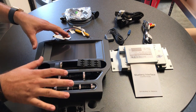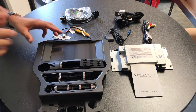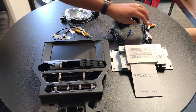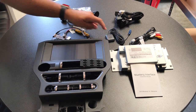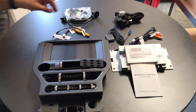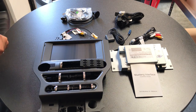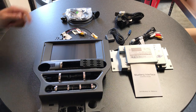In each kit you'll get the 8-inch dash replacement piece, some black tabs for your buttons, your interface piece - this is going to plug into the Sync and integrate with the factory Sync pieces. Obviously your installation guide, your auxiliary input with USB, GPS antenna for your navigation, T-harness to make sure everything's super easy and plug-and-play, HDMI so that you can stream your phone, and the rear view camera backup interface to make sure your factory backup camera works, as well as giving you an option to add one if you don't have a factory backup camera.